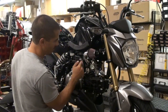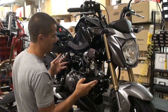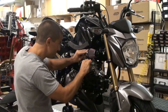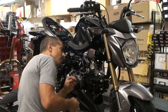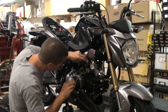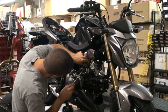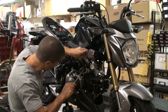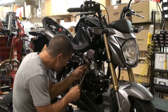and then go ahead and cinch down all the clamps. Give it a good wiggle to make sure it's nice and secure. You don't want any air leaks. That's not good. I'm going to tighten it down enough where it's nice and squished, but not where you start mushrooming out and having it fall off the back of it. And make sure the clamps are on the ends of the silicone so they get a good solid grip on them. Preferably parallel with the end of it too. It's not hard to do, but you just want to make sure it's nice and solid.